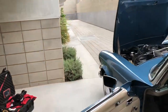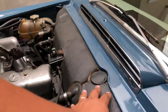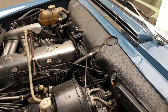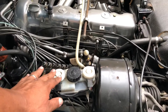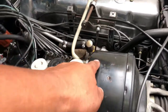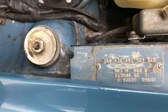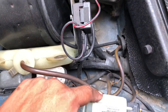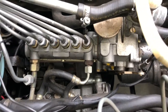Let's make our way to the engine bay. Everything looks like it's in order. The firewall insulation looks like it hasn't been damaged — it's not the original one, but the replacement looks good. Brake fluid is a little bit on the dark side, but still useful. Just a little bit of surface rust here on the brake booster. Looking at the inner wheel well area — looks pretty clean. I've got the data plate, and it looks like there's a new washer pump, so I'll be curious to see if that works. I've got the numbers on the fuel injection pump, so hopefully that came out.